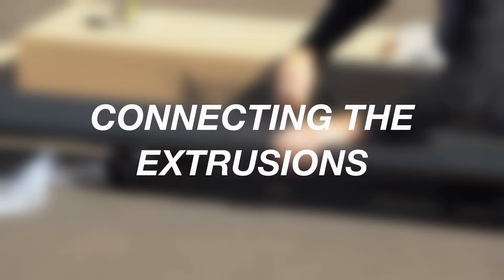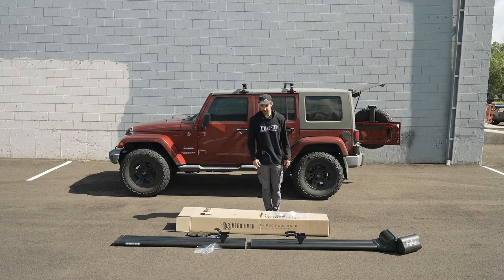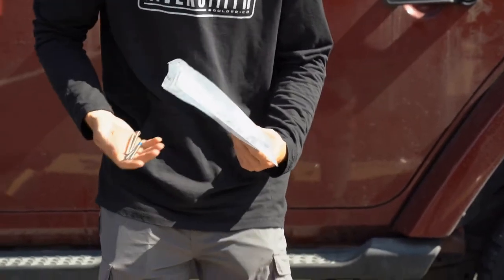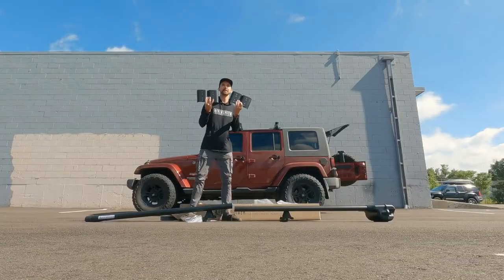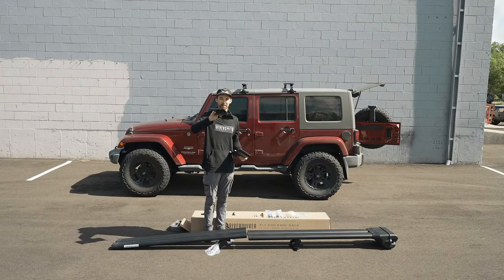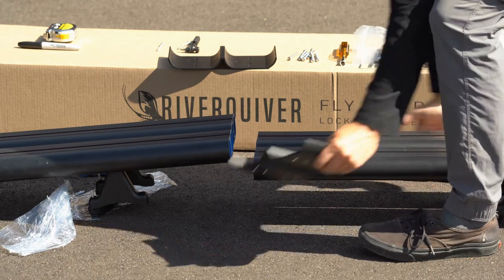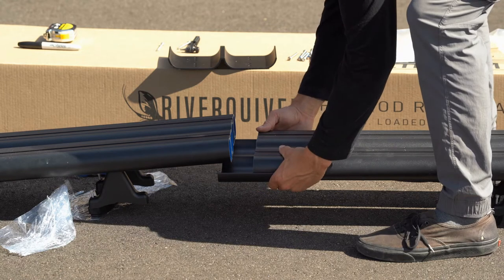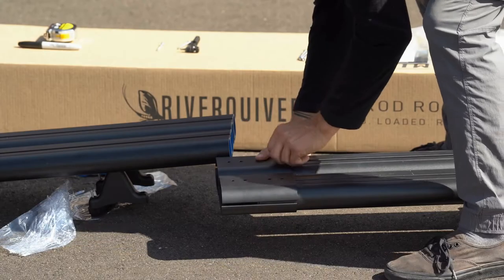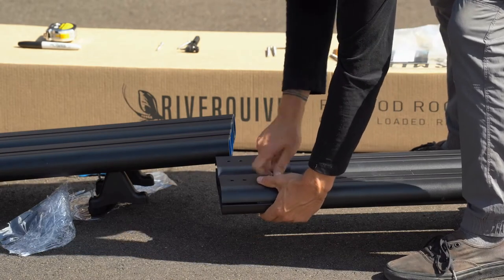Now that we've got all four brackets fastened down in conjunction with where our two crossbars are on the car, and positioned to avoid the hatch on the back, we're ready to install the coupler and join the two pieces together. We've got eight coupler bolts — for the two-banger it's only going to be four bolts. We're going to flip over both halves. One half has nuts punched into it — that's the bottom half — so the bolts can grab on and fasten down. The second half is the top and has no nuts installed. I'm going to start installing the coupler on the back half first, make sure the holes line up, and loosely put them in — no need to fasten super hard yet, just make sure they're grabbing on the nut on the other side. I like to go in a diagonal pattern as I'm doing this.